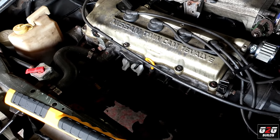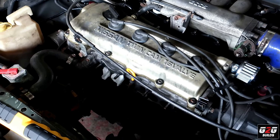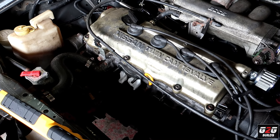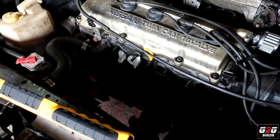Welcome back to another video. Today I'm having a huge headache with the V13. Long story short, I had a video almost ready but problem after problem showed up so I decided to scratch all that footage. I'm here in the shop with the exhaust manifold off because I was trying to get the car ready for a tune. I don't have my wideband sensor working because the bung on the exhaust is actually on the turbo downpipe and not on the old motor downpipe, so I decided to take it out to weld it.